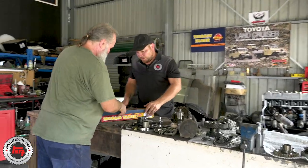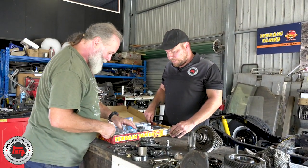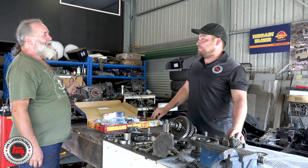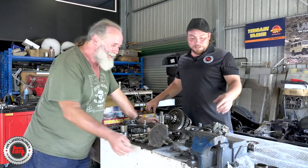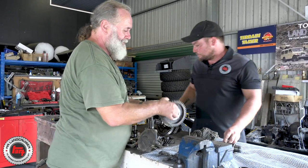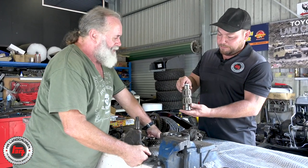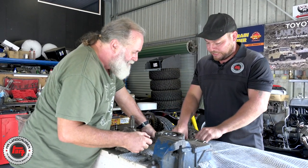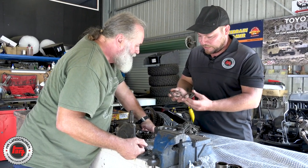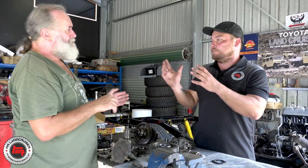This is the most comprehensive kit ever — they're awesome. So what was the noise? Well, the gearbox itself was in fantastic, almost unbelievable condition. The problem was in the transfer case on the idler shaft — the thrust washers. For those who don't know, that's your high and low range — that's the shaft that runs through the middle, and the needle bearings and cages support it. The thrust washers have almost worn right through — there's not a lot left. That'll be creating side movement, moving the helical gears backward and forward and getting worse and worse.